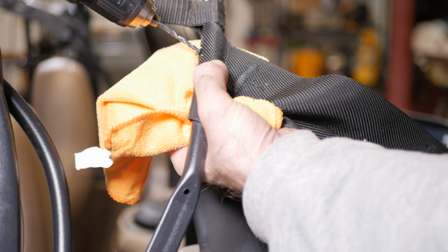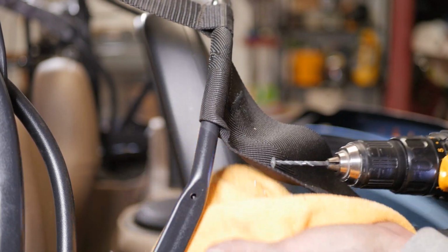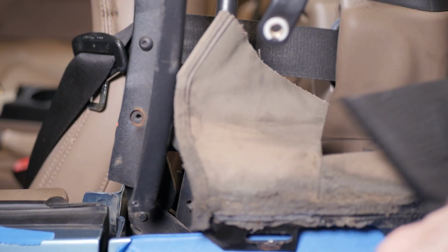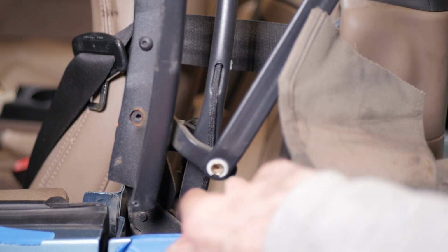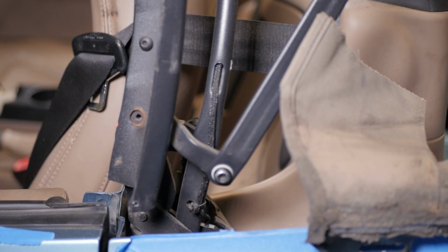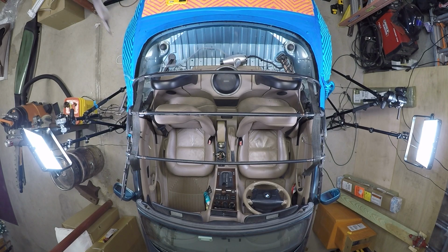The last piece of the removal puzzle is to free the tension straps from the third cross member. As I mentioned before, I didn't know at the time that I was going to be replacing these, so I drilled out the rivets to detach them. They then slide off the bottom of the cross member by removing the T30 bolt. Pat yourself on the back. The removal phase is over. If you've made it this far, well done.